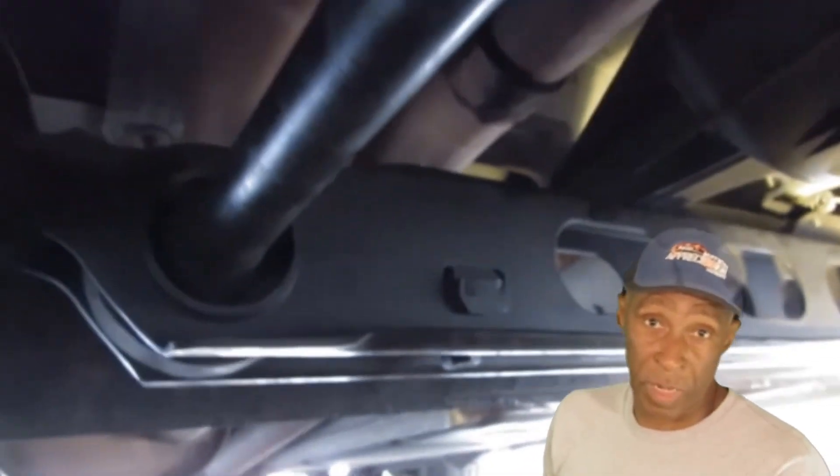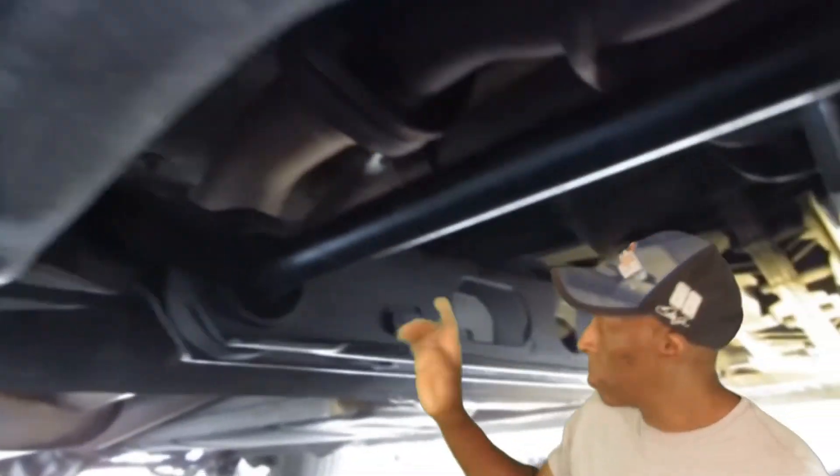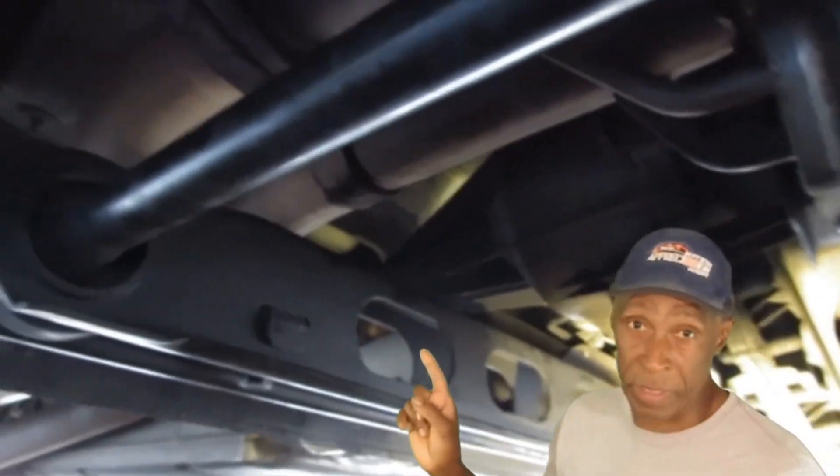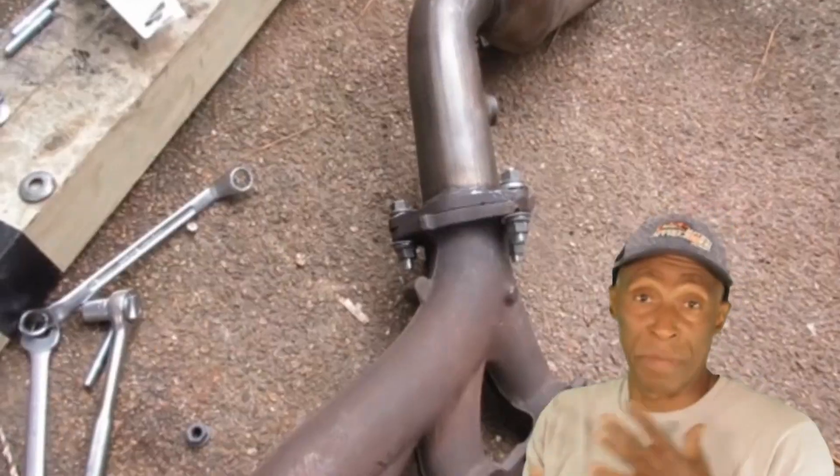Then I had to hack it. I used propane — the bolt didn't move — so I took my grinder, ground the bolts off flat, and began drilling through the iron. It was hard to do, it burned up some bits, but I got the job done. It was a big mess.